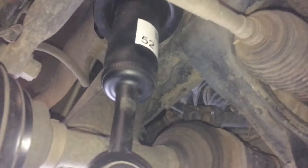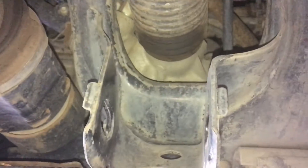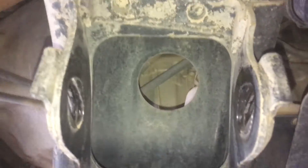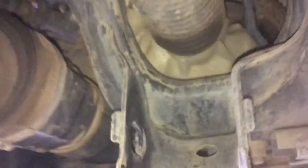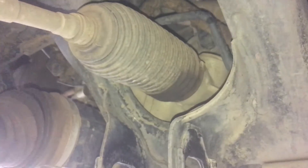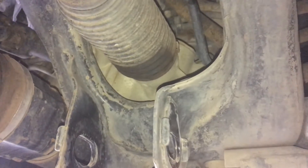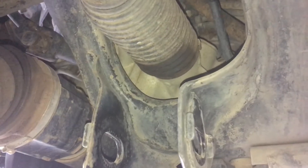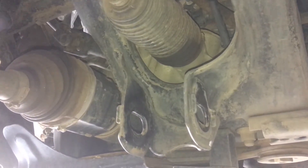And that's what it looks like — a little bit different with the new one up there and a nice new bit down the bottom. That's what it looks like with the lower control arms taken out of position — that's what the empty slots look like for those that want to know. A bit of detail like that. What size are the spanners? 22 and 30mm guys, for the nuts and bolts on here. Beware when you're taking them out, because one of them the bolt turns and one of them the nut turns — there's the front one, and the rear one's different. Just take a look and you'll figure it out.